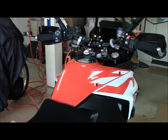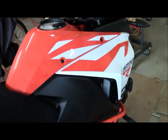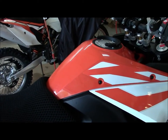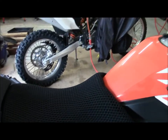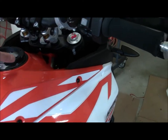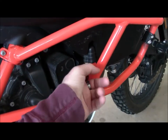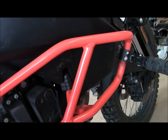I'm going to make a little tutorial video of how to remove the tank on a 1290R. To give you an overview: first part is removing the seats, then you have to remove the side panels before you can remove the top panel, then remove the tank ring, then remove the top panel. There's a bunch of stuff on the bottom that we'll disconnect as we go.